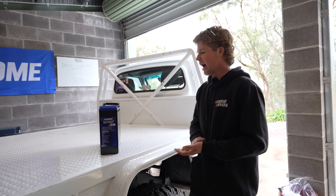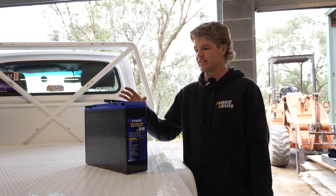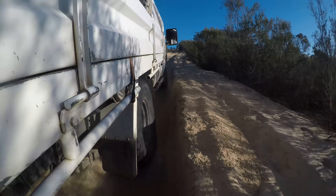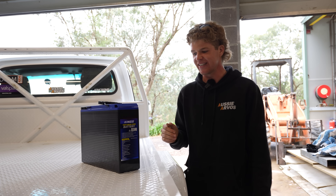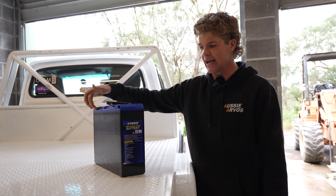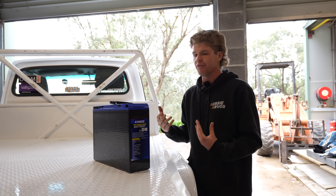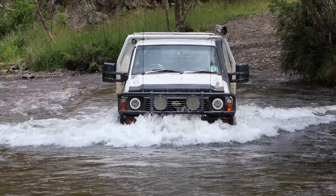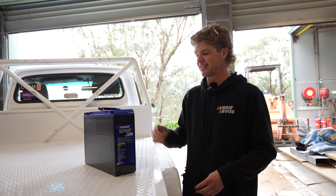It's like a super awesome fit, so it was the perfect spot to mount it. The biggest thing to consider when mounting any electrical appliance outside your vehicle is that it's going to be exposed to all the elements — water, dust, mud, sand, vibrations, climate — and this battery doesn't have ratings for any of those things. Me and Paddy looked at it and thought we can make this thing a bit more weatherproof. It appears there's only one area where water can get in between the lid and the bottom casing, so as a precaution we're probably going to run a bead of silicone around there. I don't really plan to have this submerged for more than the length of a small river crossing, and if the car was submerged above the floor of the tray for longer than that, I've probably got bigger issues than what my $400 battery's doing.